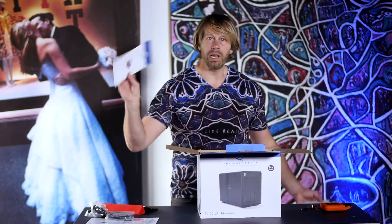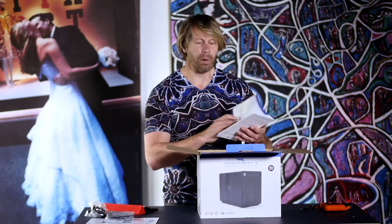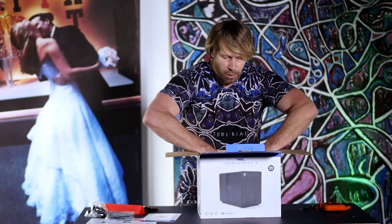There's also more information here on SoftRAID. SoftRAID is their software for setting up RAID 5 or any other RAID that you want. I run this in RAID 5, so I purchase drives that have already been formatted for RAID 5, because that's what I use. I'm using this for backup more than anything else, so that's what makes most sense to me.